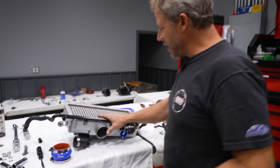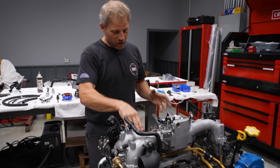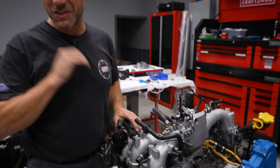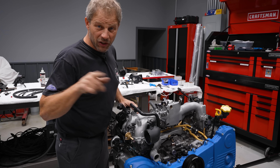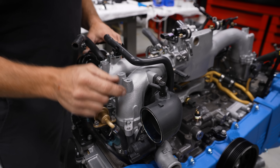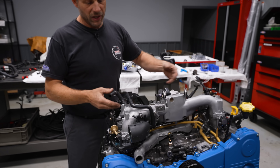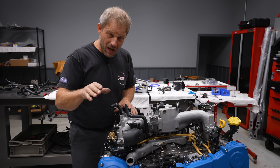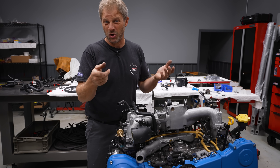You can see here I have our intercooler basically pre-assembled so I can just flop it down and hook it up to the turbo inlet. As I said at the beginning of this episode, I was going to do something wrong — wrong order — and here's one of them. This intake rail or tube had to go in before the top of the intake manifold went on. So unfortunately, I had to lift everything up, slide it underneath, and then bolt it in. For those of you that already have that message typed out ready to hit send — you might be a little quick on your trigger.